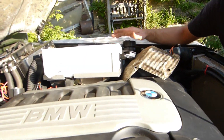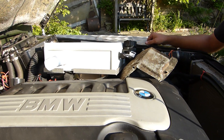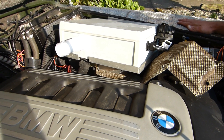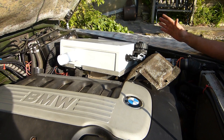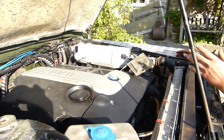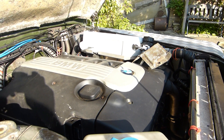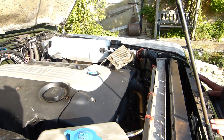The electrics are all in the big box — I'm not totally convinced, it's quite a big unsightly box, but it avoids having to extend the wiring loom and keeps it all fairly standard. We've got the ECU in there, the EWS mobiliser module, some extra circuitry for cruise control which I've sort of got working but needs more work, and fuel pump relays. We've got some cooling in there too — the BMW box had a little fan to circulate air, so we kept that in our own box, which works quite well. We do a little bit of green laning but not serious off-road, so I'm not too worried — it is a waterproof box, but it's got some openings for ventilation so it's really only splash-proof.